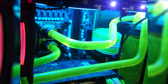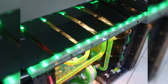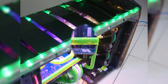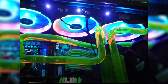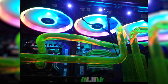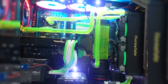For the custom work, he kept it nice and clean — gorgeous matching sleeved cables, custom water cooling with UV reactive coolant, and lots of LED lighting. The space in the case was used very wisely. The only faults I could give were different fans used throughout the build, and the fan wires up top — if they could be routed to the back of the case and then travel down, that would look cleaner. And if the budget is there, I'd consider investing in a nice GPU backplate. Apart from that, excellent build, Haz, and thank you for entering.